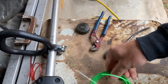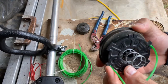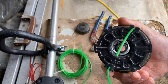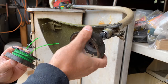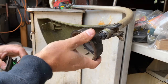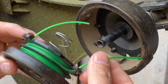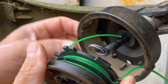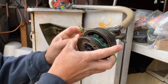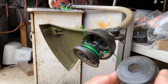Now you can put the remaining cord away until next time. You have both spools filled and the cords locked in place. Let's get to putting this thing back together — fairly straightforward from here. Make sure the inner piece is on there with the hex spot that locks into the nut so it all spins together. Then reinstall the outer piece, feed one cord through one side and the other through the opposite side, get the spring lined up, and have your locking nut and cap ready.